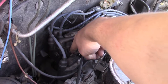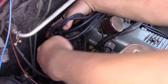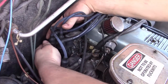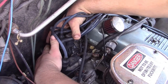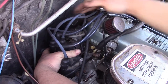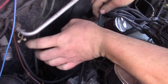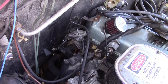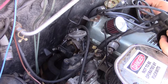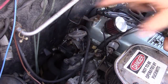What we're going to start with is we're going to pop this cap off. The last clip's a bitch - come on, let go, there we go. Pop the cap off. And now I can see the rotor's pointed over there. We'll get her pointed at kind of between three and four. So I want to point her down to number one, which is going to be about the five o'clock position roughly.